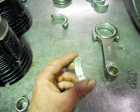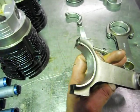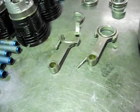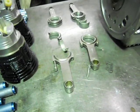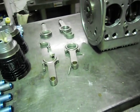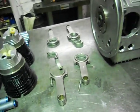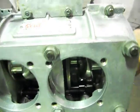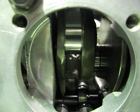There are some little scuff marks on them but not too much. Looking at the rod, it's been resized. This motor my customer bought from the United States and had shipped out here. They went to start it and it had no compression, so basically it's here for a no-start compression problem — until we found this. We pulled the rods out and confirmed that the crankshaft has been ground and is in very good condition, so it hasn't been run since whoever last touched it. You can see it's beautiful.